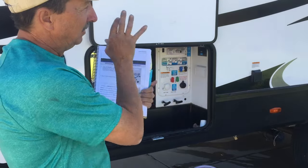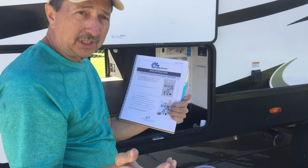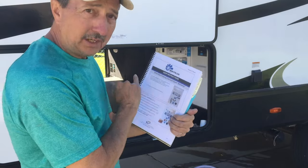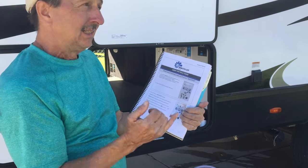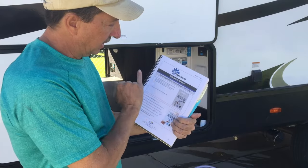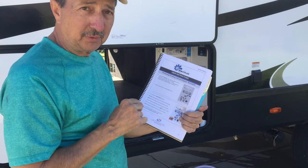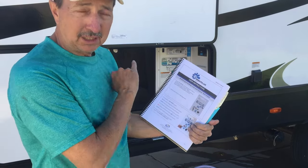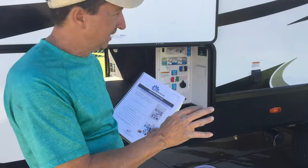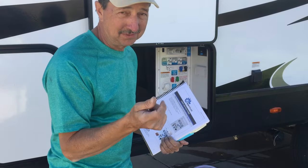If you're running water pressure from a campsite and don't know the pressure, put on a regulator. A lot of regulators go up to 55 PSI. I have one that'll go to 45 PSI and I'm uncomfortable using it. I use a regulator I can keep below 40. When I blow out, I blow everything at 30 PSI — that works great with no risk of breaking anything, mainly the water heater, whose heating coil walls are really thin.